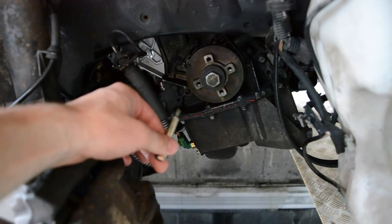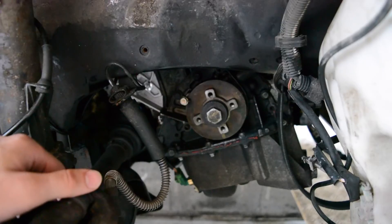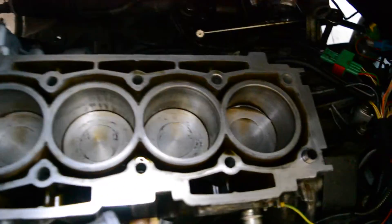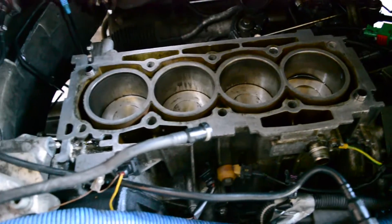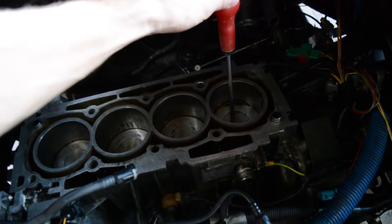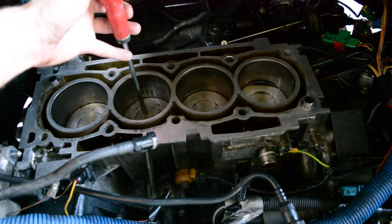If I take my lock and I lock the crankshaft wheel right there, all the pistons are in the middle as you can see. So when you are timing, all your pistons should be in the middle of your engine. You can actually check that if you got your cylinder head on the engine - you can take a screwdriver and put it through the hole to the spark plug and test where your pistons are by marking the screwdriver.